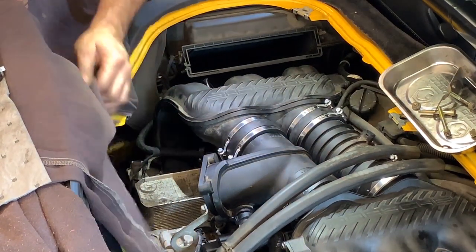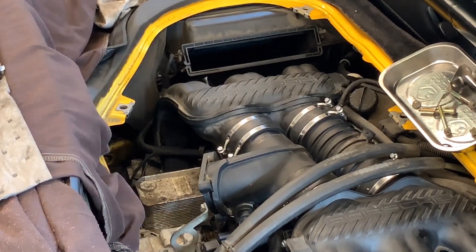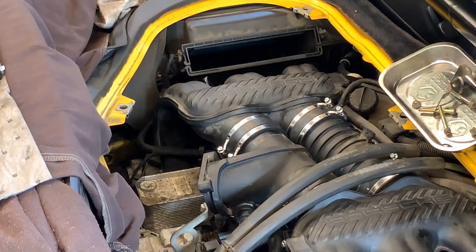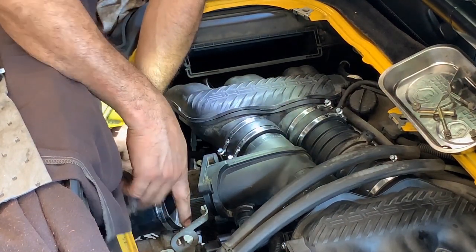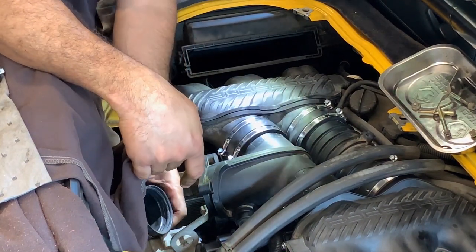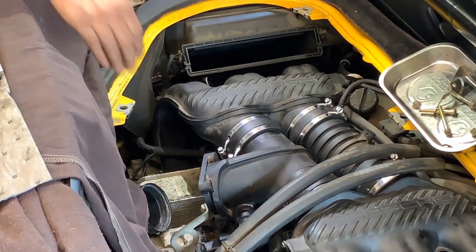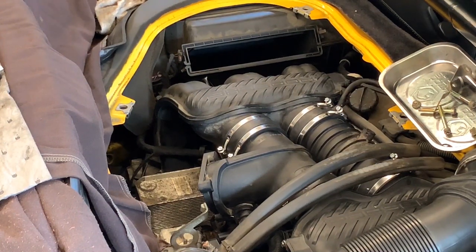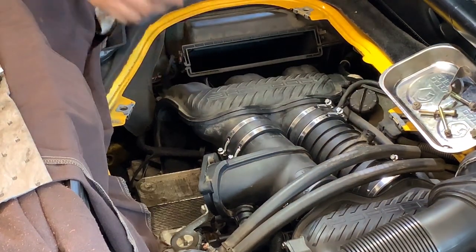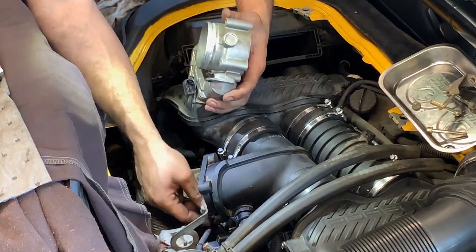Now we have throttle valve and intake hose. Get the hose in there first before you put the valve or throttle body. Either way you want to name it. Because right now there's plenty of room. So we can drop the hose in there. It's not gonna be in our way, hopefully. Because there's just no room at all. You know what? No. We're gonna have to fight it. That's gonna be just my way to put the bolt for the throttle valve. All right, we can connect it.